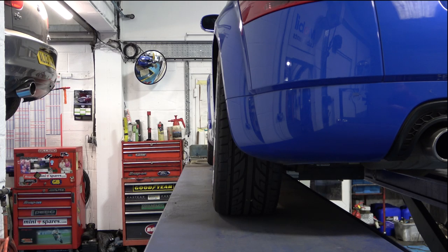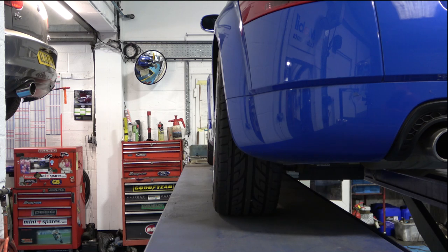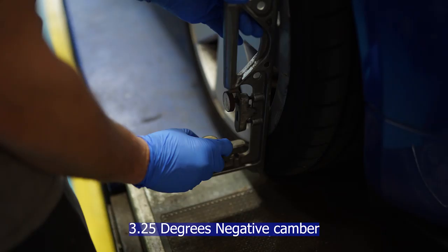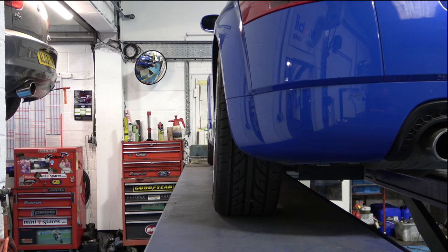There are four arms on the back of a Quattro TT and their role is simply suspension — it's to do with the travel up and down of the wheel. On a standard stock height car, the wheels will stand vertical with approximately zero to one degree camber. The wheels on this car, which has been lowered approximately 40 millimeters, sit at almost three and a quarter degrees on the left-hand side, which is quite a lot. You can see the angle the rear wheel is sitting at, which will cause tire wear and reduced handling.